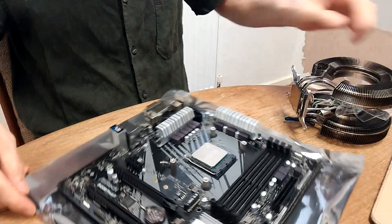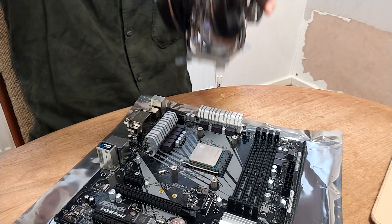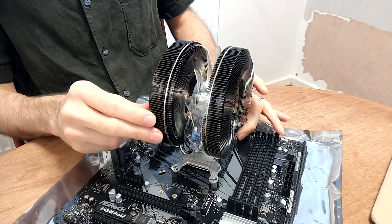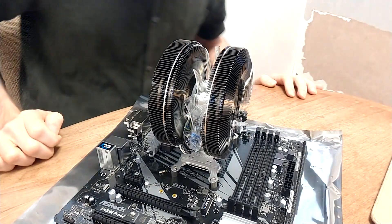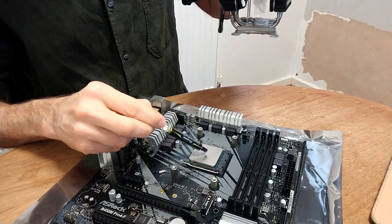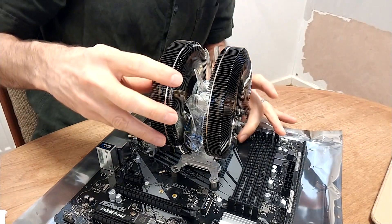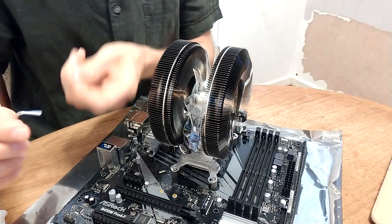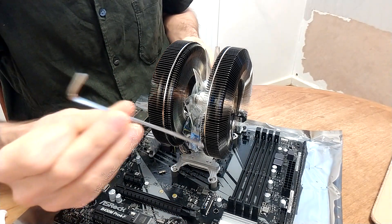What you're hopefully about to see now is that you simply place the cooler the right way round — the holes line up beautifully with the posts and you're kind of ready to go. Don't forget to put your heat paste on there — not too much — and you're ready to go. Using the other four screws that the Zalman fitting kit supplies, which are unfortunately hex heads, but it does mean they're slightly easier to get to with the supplied allen key.